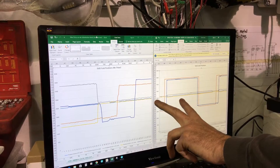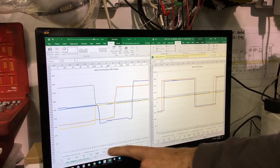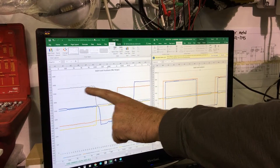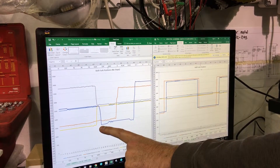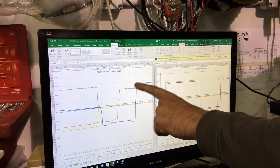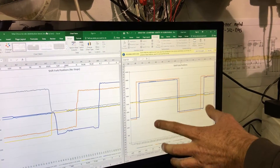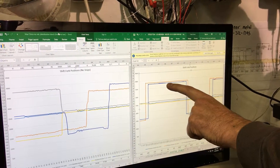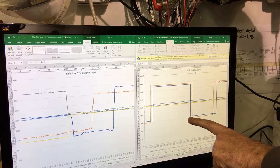Now, the reason we have these two data logs up is to show our modification to the selector valve body — it's pretty dramatic. As you can see with these jagged lines, this is stuff from harmonics and gear movement when it's in gear with everything bottomed out. Look at how much of a mess it is. When it's engaged in this gear and loaded, you can actually see the gear thrust movement — loaded, unloaded, it moves, then loaded again. Everything's moving around, everything's under strain. Now we go over to this data log with the stops — look at how much smoother and happier everything is. It engages fully in the gear, there's no thrust movement because the throw is limited, and the fork and synchro sleeve is no longer bottomed out on the gear set. And it selects the next gear nice and smooth.